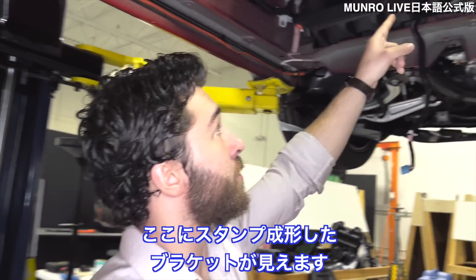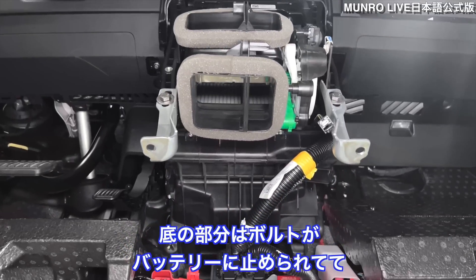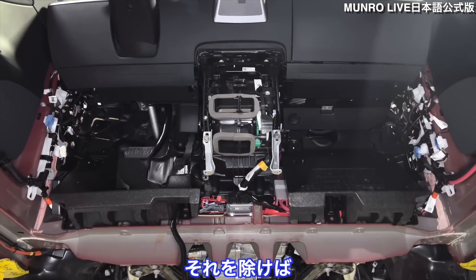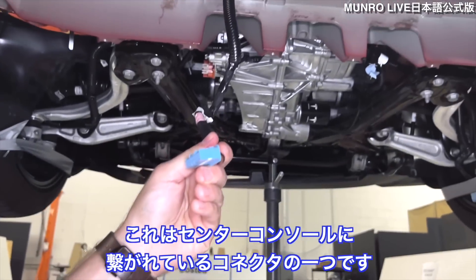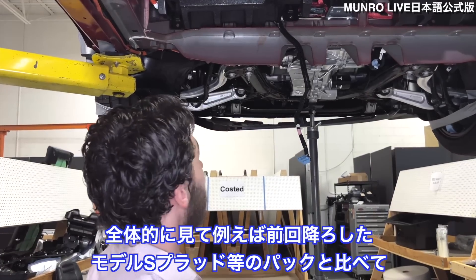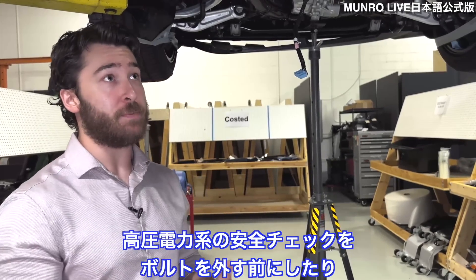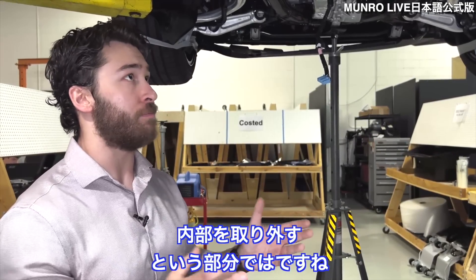Up toward the front, you can see these stamped brackets here near the HVAC ducts. The bottom is where the bolts to the battery engage — those are the only two bolts on the interior in the front of the vehicle that need to be removed. Outside of that, there were a number of low voltage connections, and each of the front seats had to be disengaged. This is one of the connectors that ran to the center console, a USB inline connection. Compared to dropping the pack for the Plaid, outside of the standard high voltage safety checks, there was actually minimal additional work required to remove this battery pack from an interior removal standpoint.